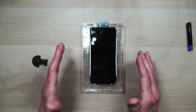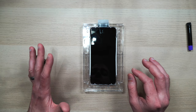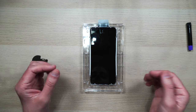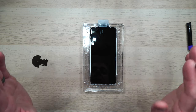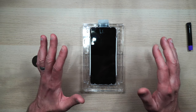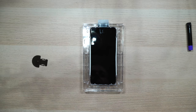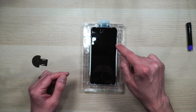Whatever you do, do not move or touch the screen at all until the adhesive has totally covered the whole screen. It may take some minutes — maybe five, ten minutes. But you want to make sure that the adhesive gets to at least all of the corners because that is the most important. Right now it only looks like one corner is our last. It looks like the adhesive has flowed over the whole entire screen — looks really good so far. I'm just going to wait for that little corner to finish. It looks like all the edges have been covered by the adhesive.